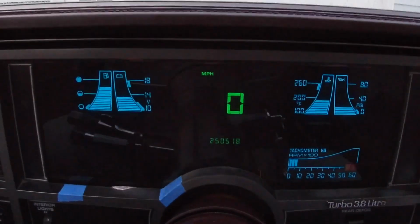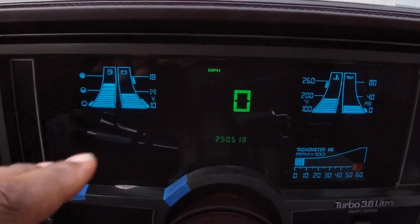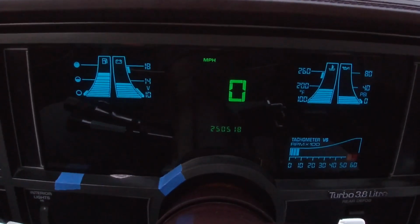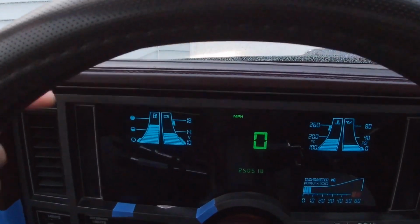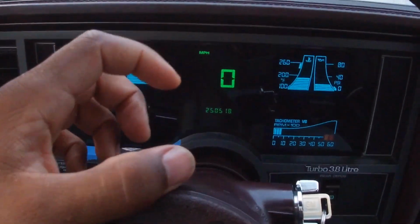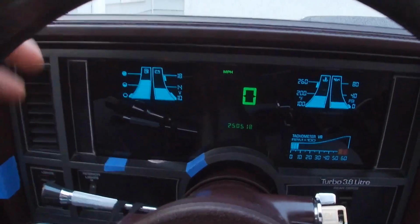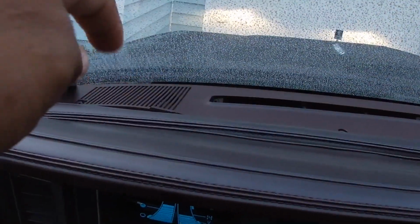However, I had an issue with that, and I'll talk a little bit about that in the next video. So I actually had to keep my cable and just wire and run my electric speed sensor into the cable where it comes up under the hood. I had a digital dash before, and I had one of those little generator transmitters under the hood anyway that was tied into my mechanical cable. So I actually just put it right in the same location where it was. It was just right here.